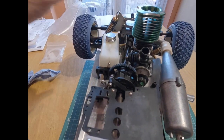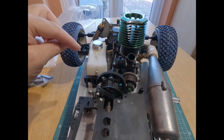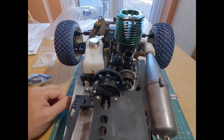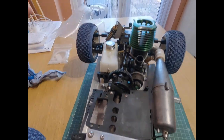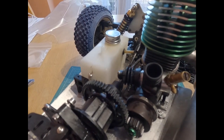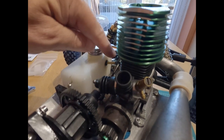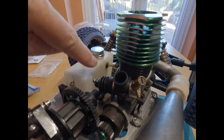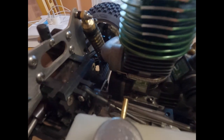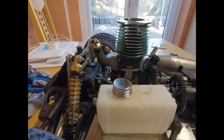If you know the sizes, you could drill it out more and fit a different rubber grommet that you know would fit, but then you start messing around. I've seen it on other tanks where the pickup goes straight down into the bottom of the tank, which makes sense. But this is the design we're faced with - and it is at an angle. The tube should really be coming out of the tank straight, which it isn't. Anyway, this is a bit of a test bed. We're going to put some clear tube from there to the pickup of the carb and just route it around somehow. I'm going to give it what they call an RC blow job and see how much pressure is held in the tank.